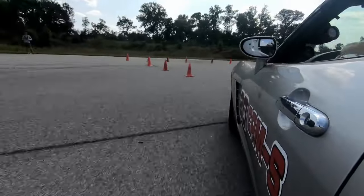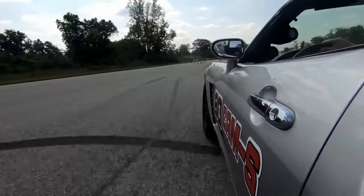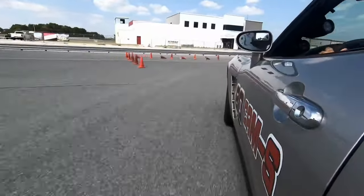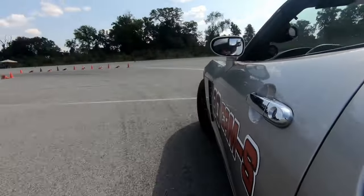I'm kind of a different case because I autocross my car and I change my wheels — the last few years I've been changing my wheels back and forth from daily to race wheels probably three or four times a month. I would probably change my wheels in one or two months more than a typical person would in an entire lifetime. So obviously that put a lot of strain on the studs. I would typically use an impact drill, and if you tighten down with an impact drill and it does that rapid spin at the end, even if you hand tighten after, by then it's too late. The impact drill gets going so fast on that stud it causes it to heat up, and when you do that many many times, that causes a serious issue.